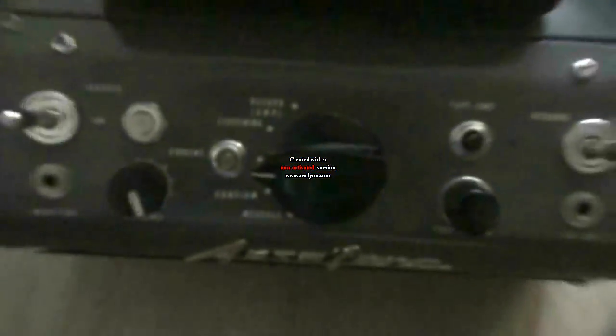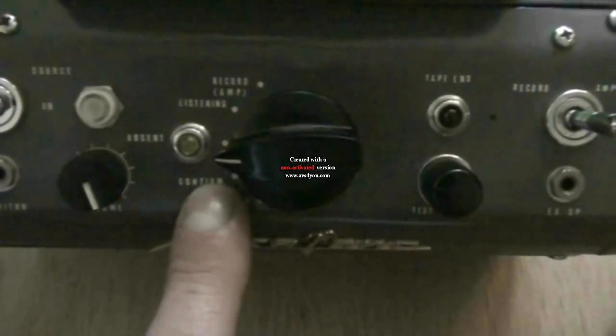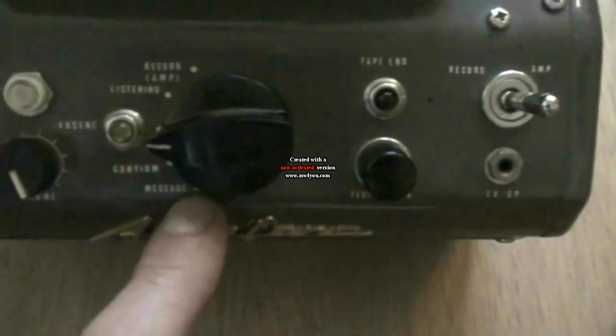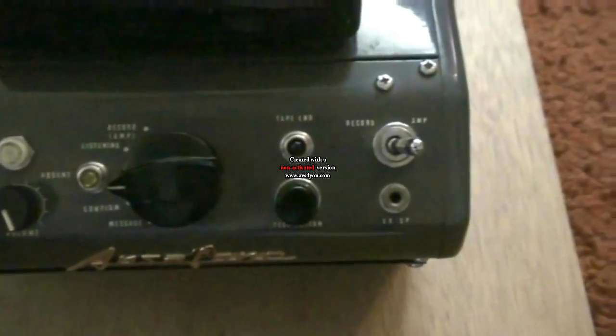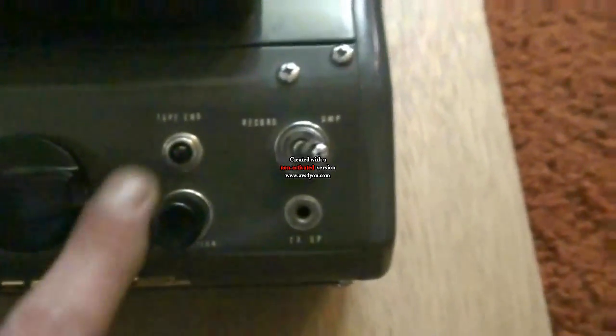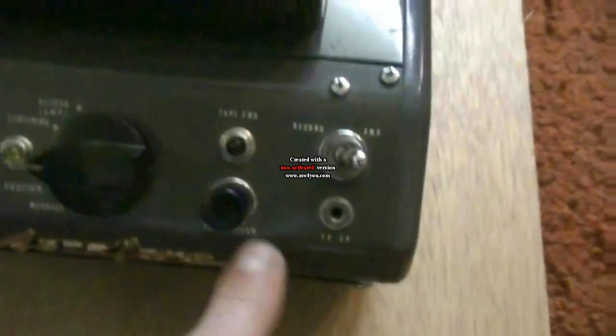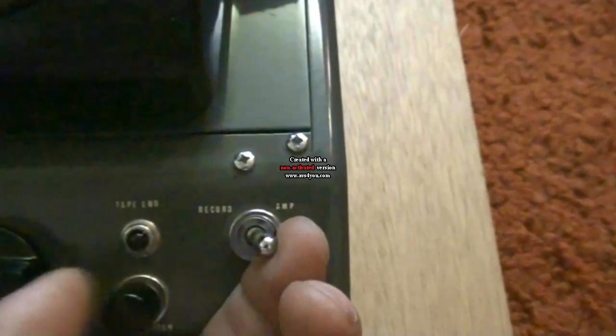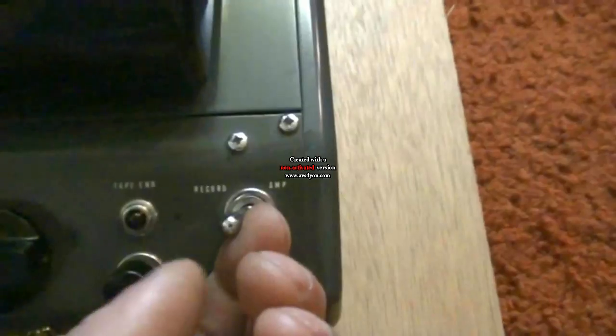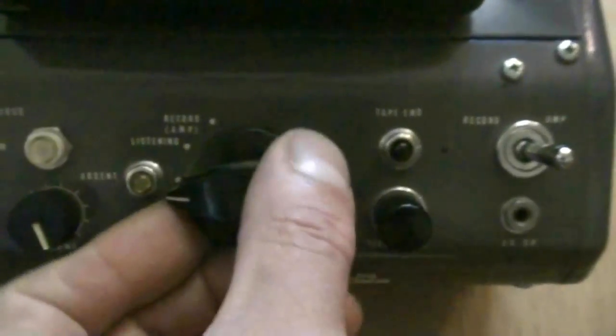Here we have 'Confirm', which is to play back your outgoing message. 'Message' is to record your outgoing message. 'Listening' plays back the message tape for the incoming messages. And 'Record' allows it to function as a recorder — either to broadcast or record your telephone conversation. There's a simple tape end indicator, test button, a jack for an external speaker, and a jack for a monitor speaker. This switch selects, when it's in the record or amp setting, whether to record your conversation or amplify it over the speaker. The center setting — 'Absent' — is when it is set to auto answer.